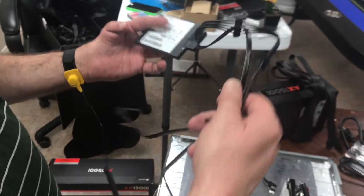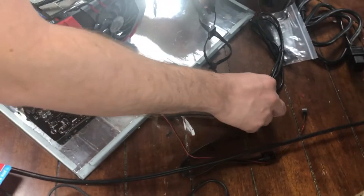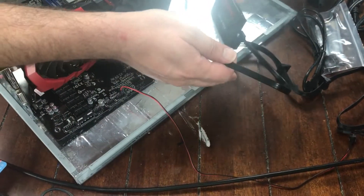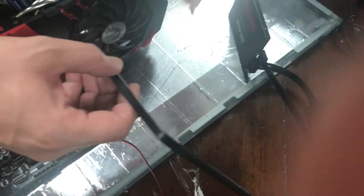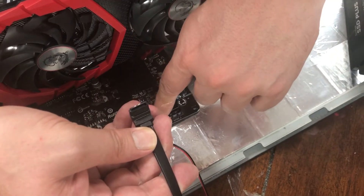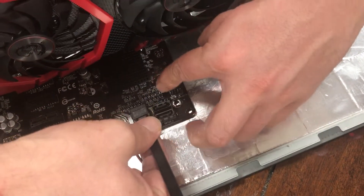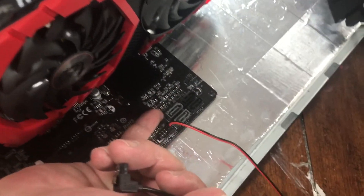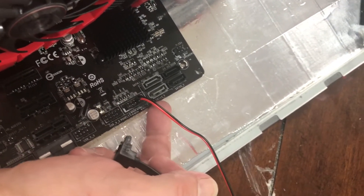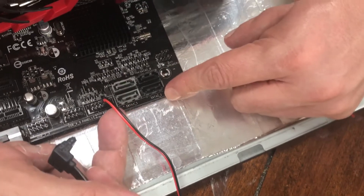Let's go back to our motherboard — we're going to connect it. As you're putting it together it's going to be a little messy like this, but that's to be expected. We're going to clean up at the end of the day. On the opposite side, you have another connection. We're going to put in our SATA 3 — that says SATA 3 0, and down here it says SATA 3 1. Although these look similar, the gray ones are SATA 3s and the black are SATA 2. SATA 3 is, of course, going to be your newer one.